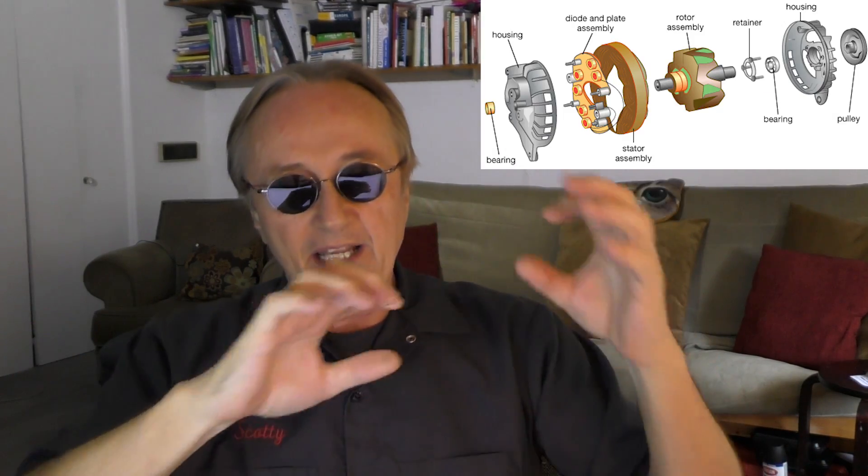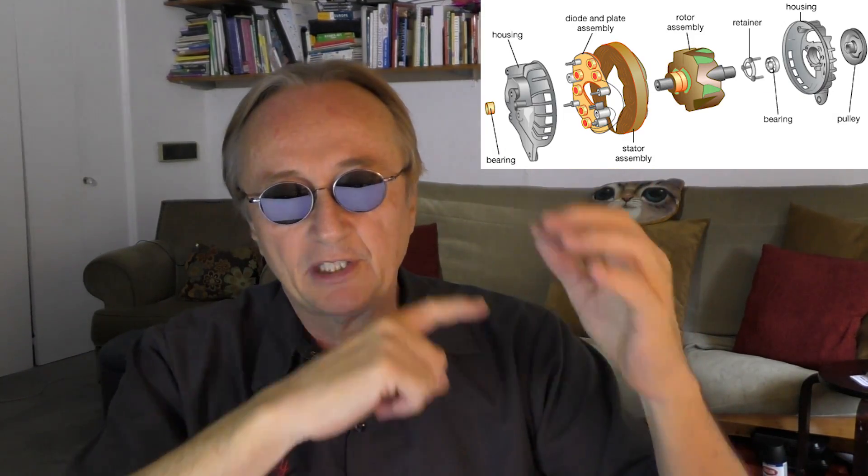Master 767 says: I really wish I could know what causes a battery overcharging in my car. Batteries are charged by the alternator. If an alternator goes bad it can easily overcharge the battery. They're called alternators because they create alternating electricity. They have diodes, and the diodes turn the alternating electricity into direct electricity. If those diodes start to go bad, it can actually put a bunch of alternating electricity — sometimes as high as 80 or 90 volts — into the battery, and it'll overcharge it and destroy it.